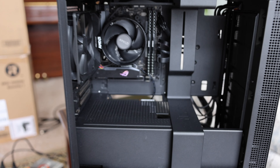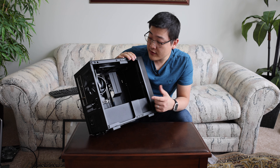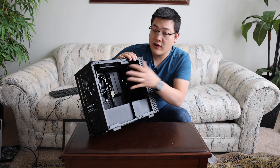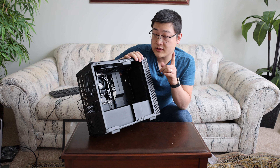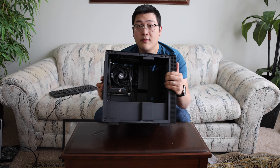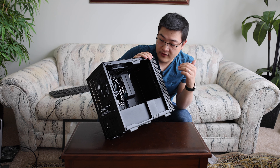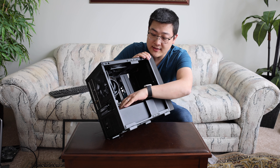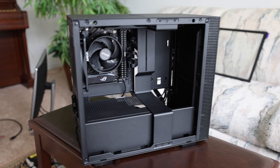Inside here you can see I've already got the motherboard placed in and it's actually completely built. This is an ASUS B550i gaming motherboard with a Ryzen 3 3200G, so no GPU — just all integrated. You can see I've got a lot of space for the GPU. This can basically fit as big or as long a GPU as you want. However, one thing to note is that there are only two PCIe slots on the bottom here, so the GPU cannot be too thick. If you go with a two-and-a-half slot GPU with extra plastic, you're going to run into an issue with the bottom shroud. The bottom shroud does have cutouts so you can potentially be pulling air through it to the GPU, but make sure to stick with just a regular two slot GPU.